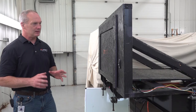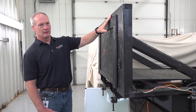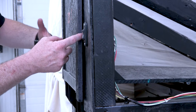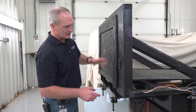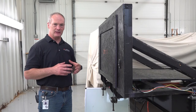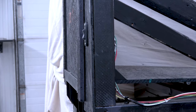Do this by running your room out and running it back in. When the room comes back in, you'll notice that the top of the room touches the unit first. There will be a gap where the bottom seal hasn't sealed yet — this is normal after adjusting head assemblies. Pull the room back in fully and you can see it's sealed all the way along the top and bottom, which is correct.